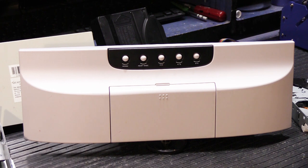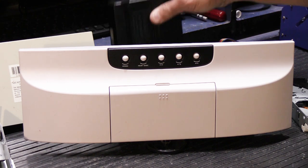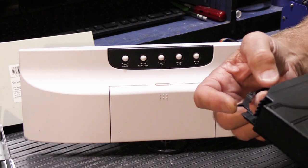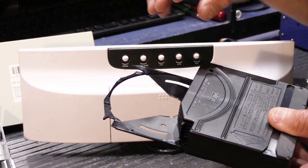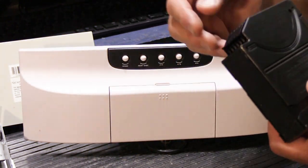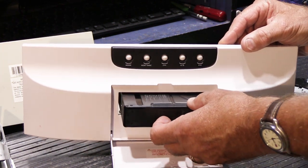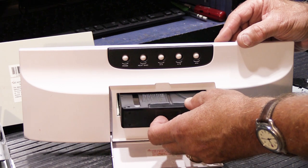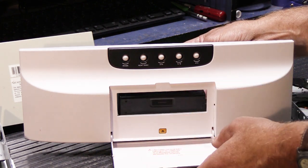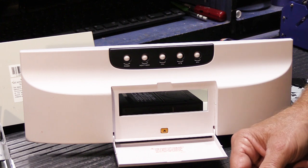The number one problem with these is that the cartridges the CDs fit into get stuck inside. Here we have one of the cartridges. It's a fairly standard CD cartridge design with little trays that slide out — you put your CD in the tray and it pops back in, and you do each one until all six are full. Once full, you open the door and slide it in, the mechanism senses it, the gears turn, the motors go, it pulls the cartridge in, and then automatically goes through each tray to see which ones have CDs.